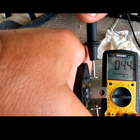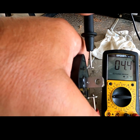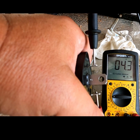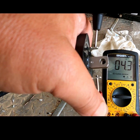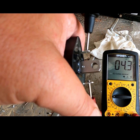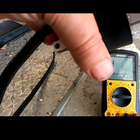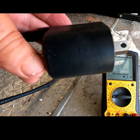Here on the top, and you should have 3.6 to 4.8 ohms. Now that is at 68 degrees, so if it's wintertime and you're checking it, take your ignition coils off and take them in the house where it's warm.